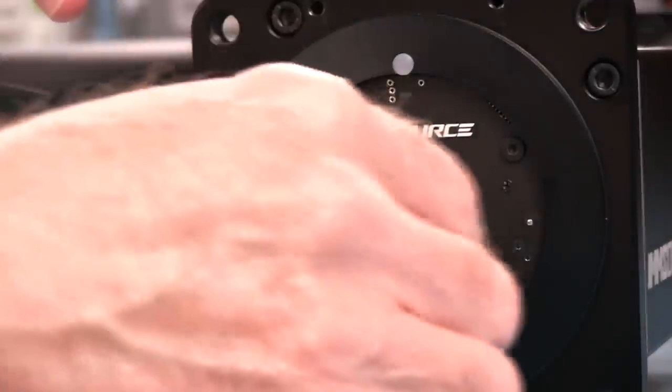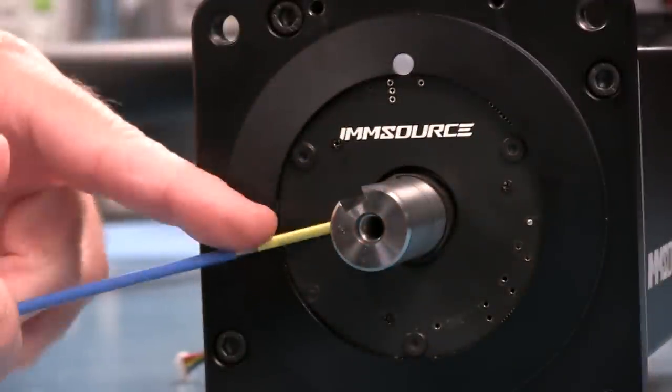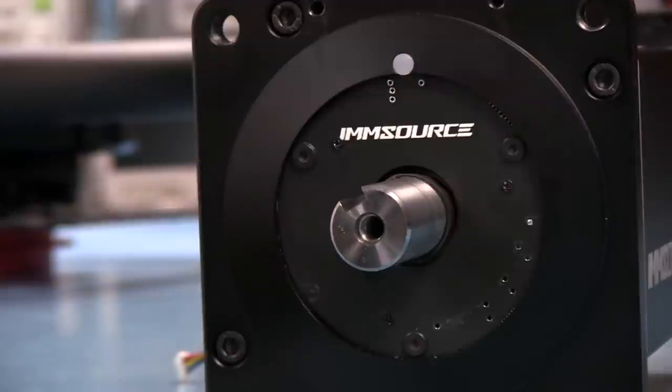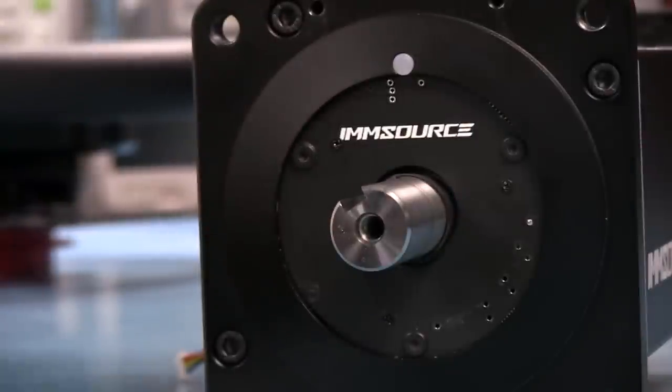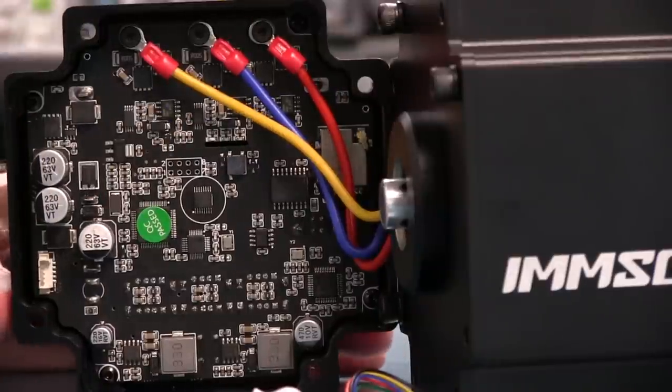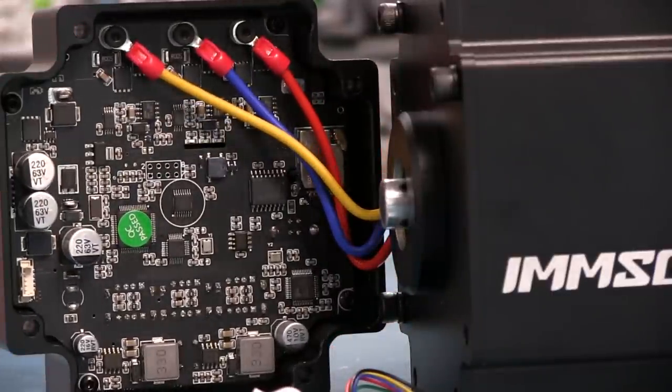And of course, those wires, like I said before, are servicing our coil and electronics package up here that's doing the coupling, electromagnetic coupling, to the coil that's in the hub that we saw a second ago, right? To get the current to flow so we can power our steering wheel. So yeah, I guess that's about it as far as what you want to see in something like this. Very clean. I'm looking for stuff to complain about here, but I think it's a well done package.